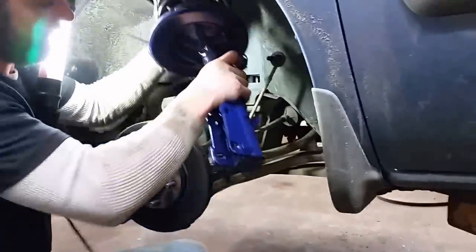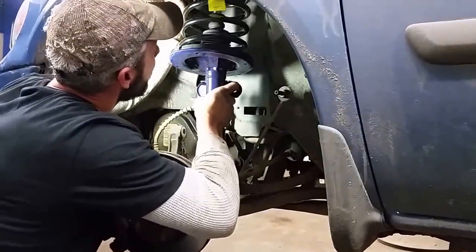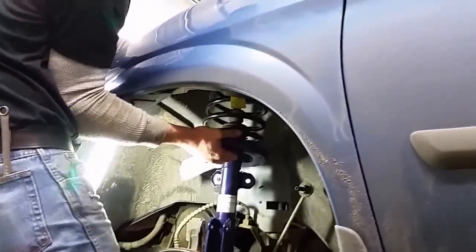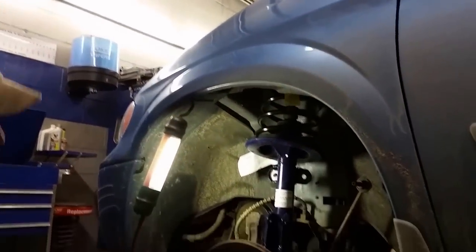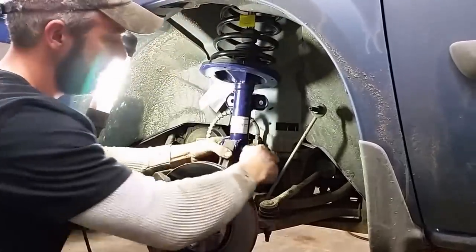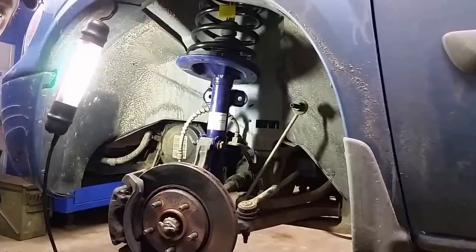This could be a little tricky — kind of got to go at it blind. But you just slide your strut up in the same track where you took it out. Get it lined up with the hole. Hold some upward pressure on it. Put one of those top nuts on — just hold it, get it in there, it'll hold itself. Line it up in your steering knuckle. Lightly put in that bolt. Now we're going to raise it up and finish putting it together.